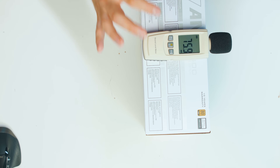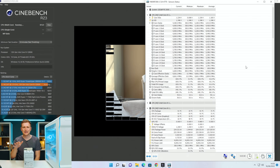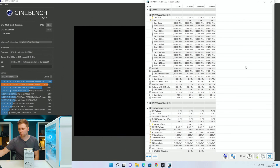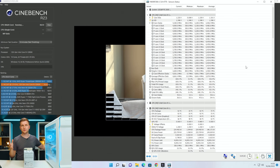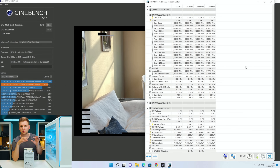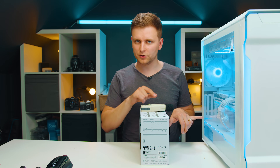We're roughly about 40–41 dB at 100% CPU utilization. At about the same point as the previous test we're at 90 degrees and pulling about the same wattage — but look at the decibel meter: we're at 43–44 dB compared to 44–45 before. Bear in mind it's been about an hour since filming this, there's another PC behind it that's been recording and producing heat, so there's a lot more heat in the room. In the worst case, our cooling performance is absolutely the same, but now it's much quieter — especially at idle. We're about 40 decibels, which is actually three decibels quieter than before.